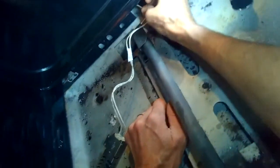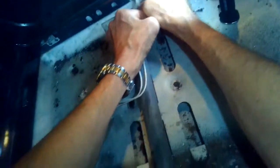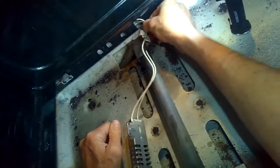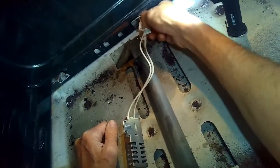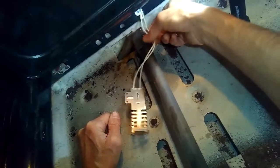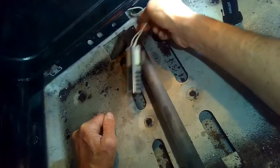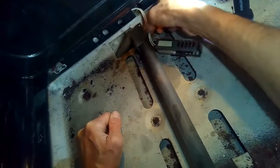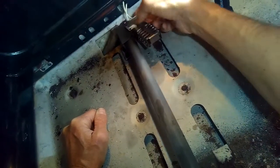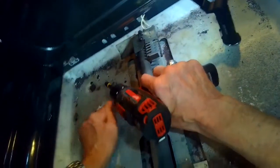We're pushing the wire now into the firewall into the frame to get it out of the way. You can always cut this wire shorter too if you'd like. You don't want a lot of wire exposed because this part of the oven gets really hot, so you want to get the stuff behind the firewall. Some ovens have a round igniter like the GE ovens, but it's pretty much the same procedure. Most other types like Whirlpool, KitchenAid, and Bosch all have the same flat-type igniter.